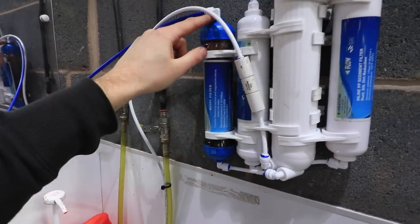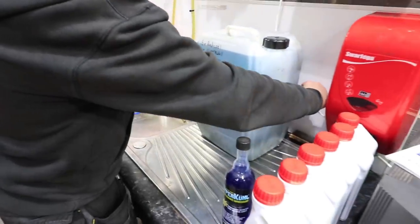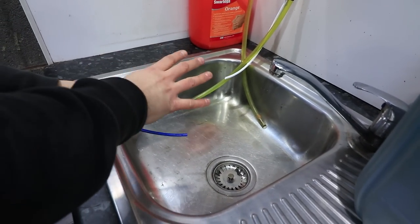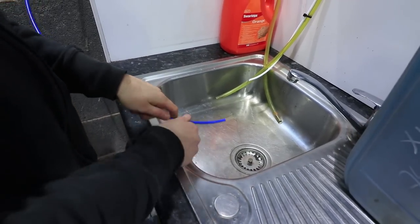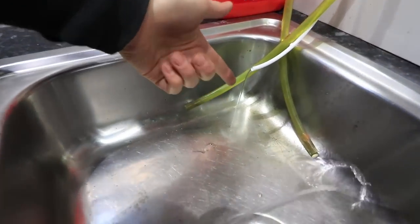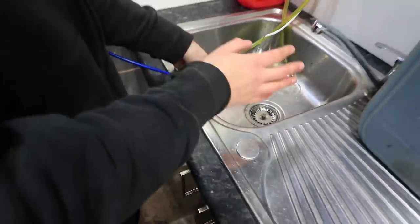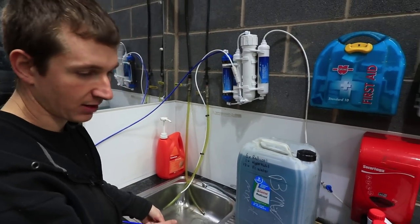This pushes clean good water out. It'll probably come out a bit murky because it's a new set we've only just put in — it's cheaper to buy brand new than replace filters. The rubbish comes out before the good stuff, so this water has all the contaminants in it, and then this water is clean. You've got to run about 15 liters through it first because it might still have contaminants in.